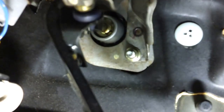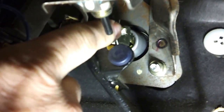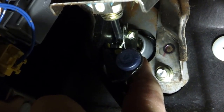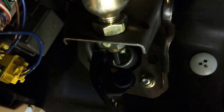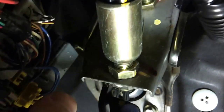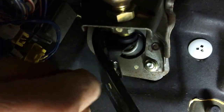So we can go take a look at the clutch pedal. Here it is. Here's our issue. I've got to remove this cotter pin to get the pin out, to disconnect the pedal from the clutch master cylinder right here. It's defective on the other side. If you ever want to know why you've got to push in the clutch pedal in order to start the car — this is a safety switch right here. If this is in, it will not allow the ignition to occur. So when this pedal is up, it won't start. That's why you've got to push your clutch in. This pin pushes out, and it will allow you to start your car.